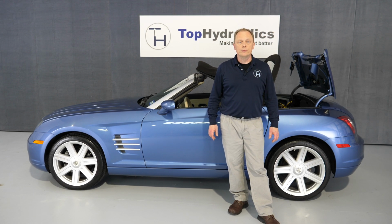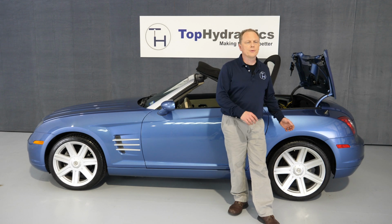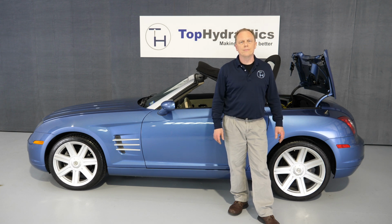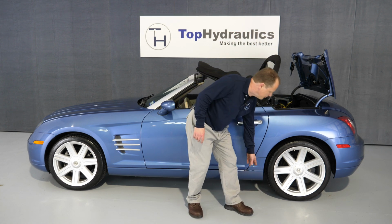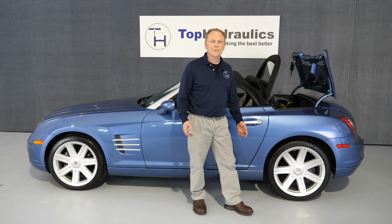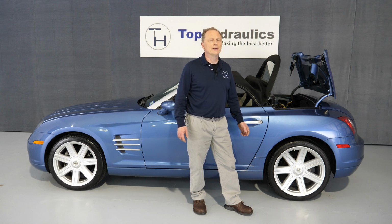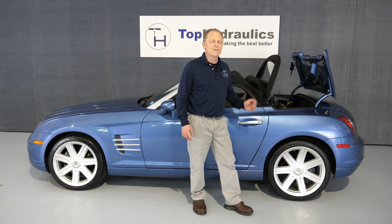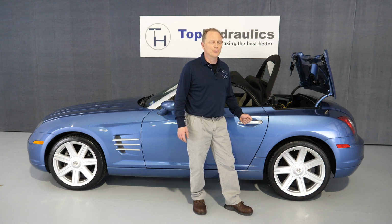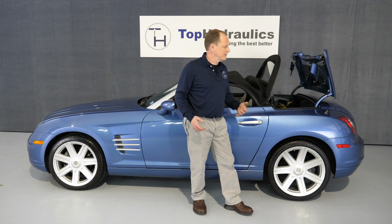I want to talk to you a little bit about troubleshooting the hydraulic system, just the basics. Either your top doesn't work, or you see some leaks on the floor in front of or behind the rear tires, or your pump is making some weird gurgling, loud, unusual noises. Typically, if you've owned your Crossfire for a while, you can tell when you're running out of fluid on the pump because the sound of the pump changes. It just gets louder because once it sucks air, it cavitates.